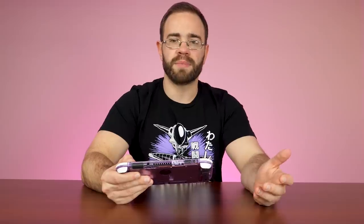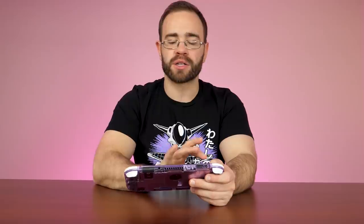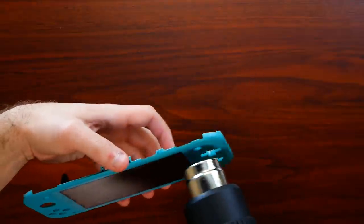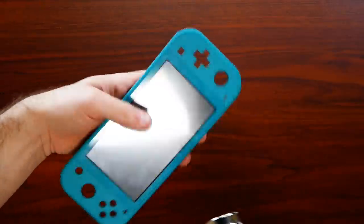The question was: are we going to remove the screen from the digitizer? I figured not, since that would be a very weird thing to ask people to do to reshell their Switch. Unfortunately the solution they went with — I'm not a massive fan of it. It feels like a tacked-on solution and it might cause some issues if your front screen protector gets damaged. To remove the screen, you heat the front with a heat gun — specifically the front, not the back — to loosen the strip of 3M tape holding the screen in place.